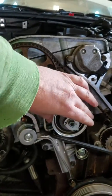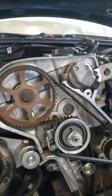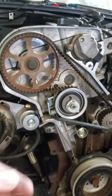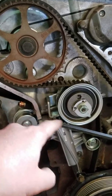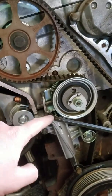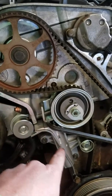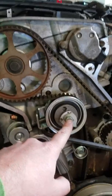Get it around the eccentric pulley, around the water pump and the cam sprocket. The reason it's so much easier to do it with the tensioner out of the way is because the lever on the eccentric pulley can only move down another eight millimeters — that's the size of this Allen key I just have sitting as a wedge in here. With it out of the way, you can actually rotate this down all the way. Also just leave the nut on the eccentric loose for the time being.